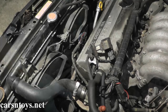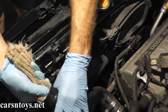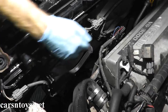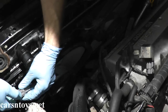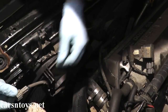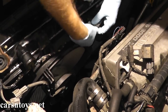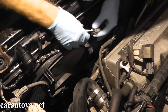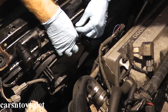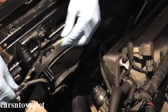Because this is a twin fan setup, you have two harness connectors, so we need to disconnect both of them. There's a little tab here — you just press down with your thumb and remove the harness. It can be a little tough sometimes, but always pull or push from the body, never from the wires.